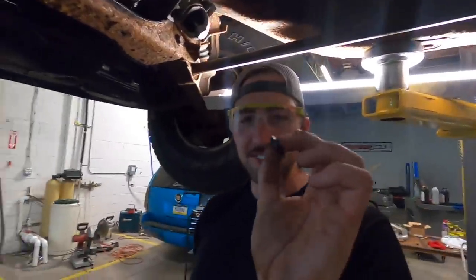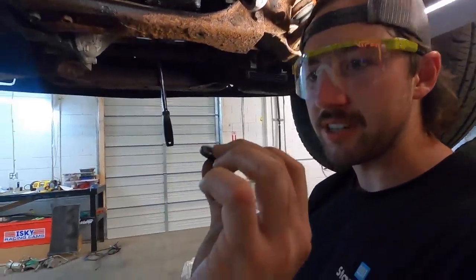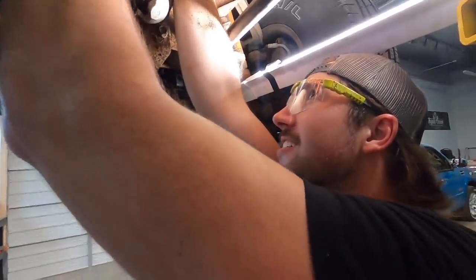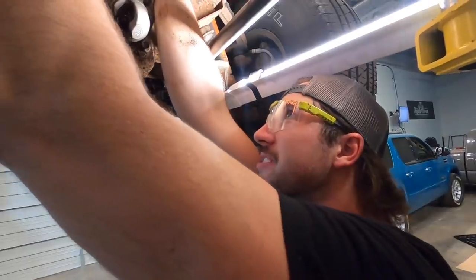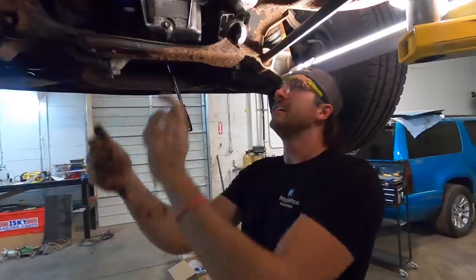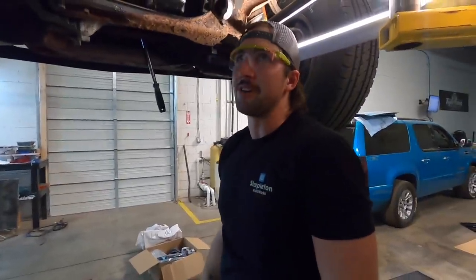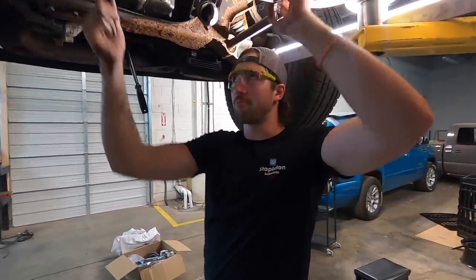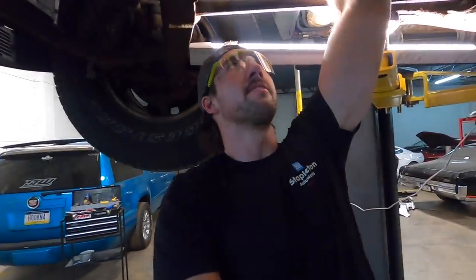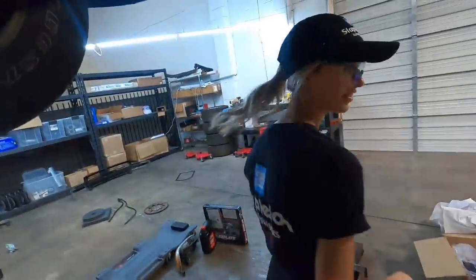These nuts are still stuck together by hot glue — actually I think I just broke them. Oh, that one went in way easier; I'm getting pretty good at sliding it in. You know, this thing's just like some old wallered-out truck motor — you can turn it just by grabbing the flex plate like a piece of pizza. I don't think I could do that with the 427, the compression's too high. But we got these in now so we can actually get a ratchet wrench up in here and tighten these converter bolts.